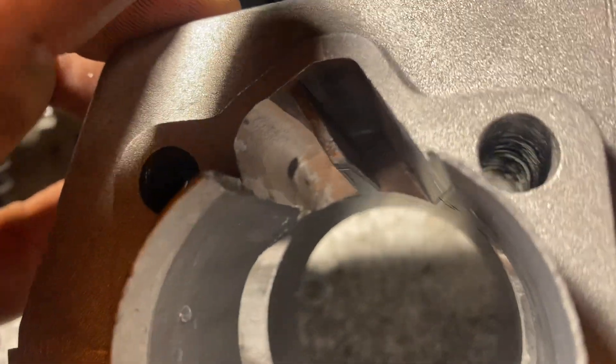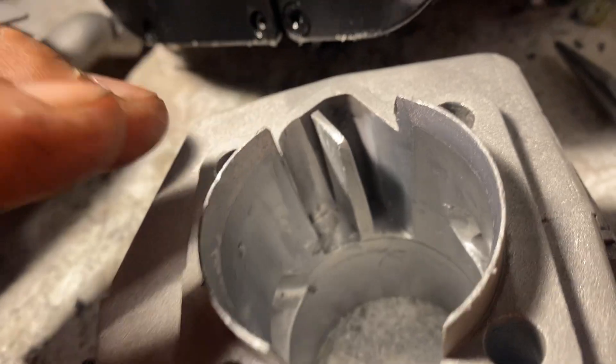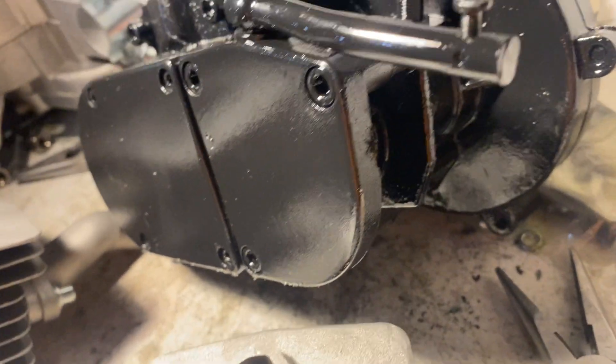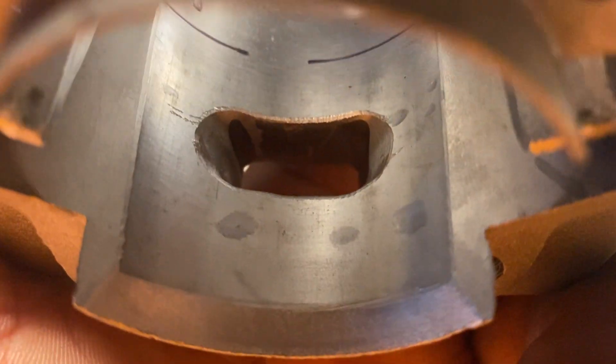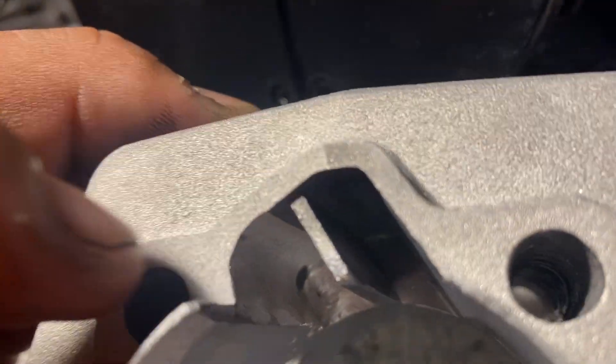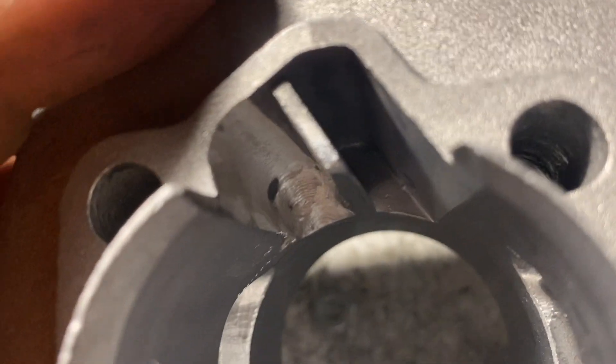It's aimed towards intake now. I've already done this for two cylinders being ridden by local people, and the power gains are obvious — the low-end torque gains are major. Even with conservative ports: about 128 degrees intake duration, 160-degree exhaust, toe shape, maybe 28 millimeters wide. So even with conservative exhaust and intake port sizes — I usually go much larger, around 70 percent of bore with better intake duration — the transfers are making a major difference.